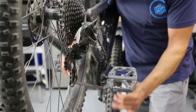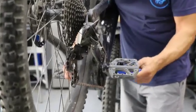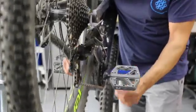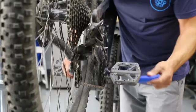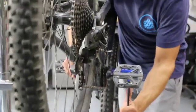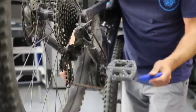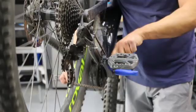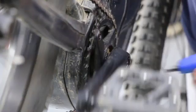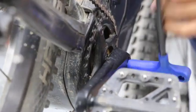There's a lot of resistance but it's staying consistent. If you can't get a good revolution and it just gets super tough, you may be going the wrong way. This one is coming off harder than average, but it's still moving, so I feel good about not destroying anything. We should start to see a gap develop as the crank arm separates from the chain ring. It gets easier as I get a better angle.